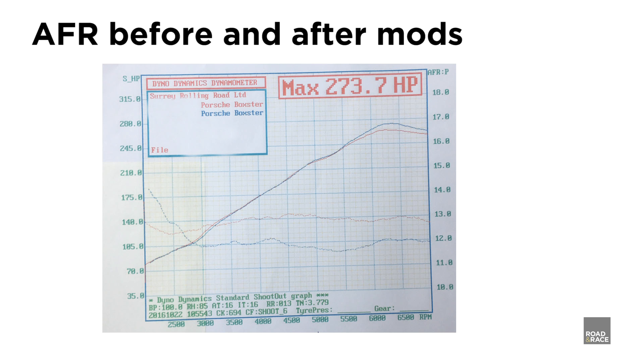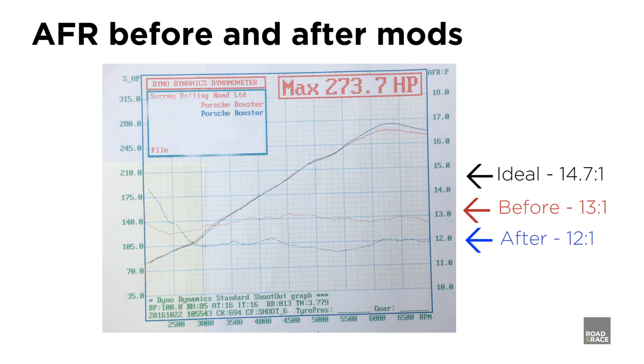Here's another graph showing the air-to-fuel ratios. Without going into too much detail, the ideal ratio is 14.7 to 1. From what I've read, in the real world you should expect something between 12 and 13 to 1. So the car is running a little richer than it did before all the mods, still within safe limits — just burning a bit more fuel than before. Simple tests via the trip computer show fuel economy to be roughly the same. As the car was running richer, we took it back to the dealer.